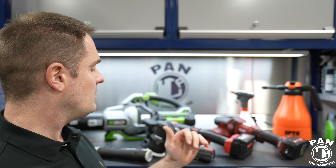Let's start off with a few of the machine polishers. When you're doing paint correction, you need a machine polisher — whether you're using rotary, dual action, forced rotation, or direct drive — to correct and level the paint, remove defects, increase gloss and clarity, remove swirls, scratches, and oxidation. We've been used to corded versions for a long while, but having the cords is a hassle. You often need extension cords, and if you're a professional working in a shop with many tools, managing all that cord and clutter can be quite tedious.